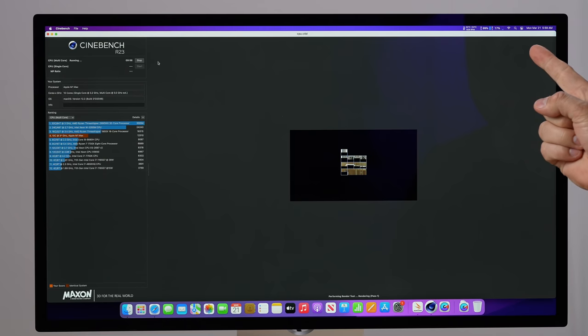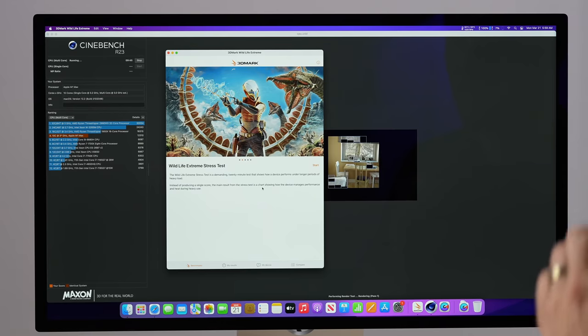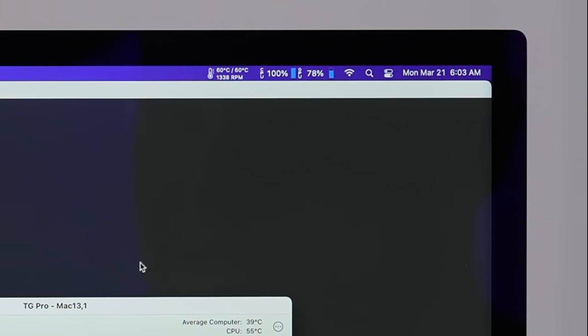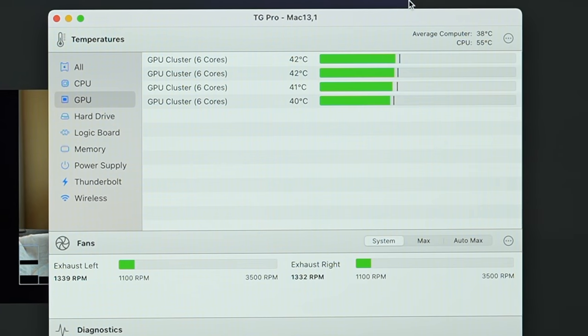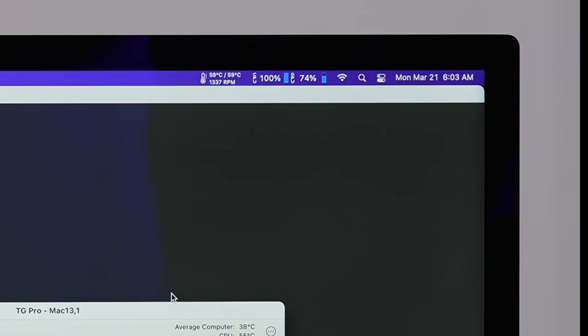Now let's push this machine to its limits — starting up Cinebench to max out the CPU, and then once it hits that 59°C we'll kick in the 3DMark extreme stress test as well. After about 20 seconds, this is very interesting: the CPU went from 58–59°C and is now steady at 60°C. The graphics cluster is at 42°C — insanity. But I just made a discovery: the GPU is not fully maxed out, starting at only 74% performance compared to 100% before.